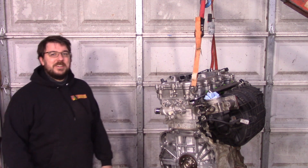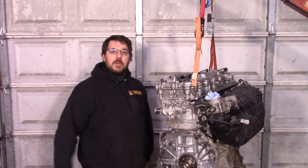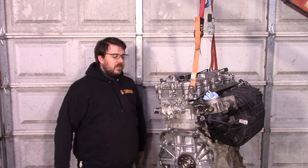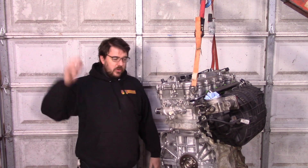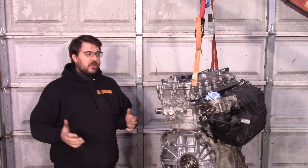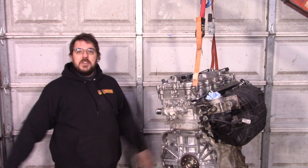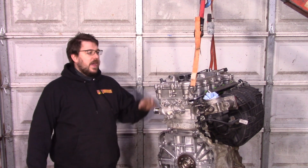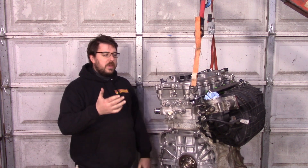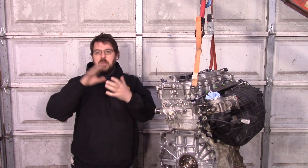That moment you just saw — you have no idea how sweet that was, because that was a confirmation. That was the first camshaft that I have run in an engine that I created entirely from scratch, not just calling up and saying I want a 240-degree cam. Every last point on that lobe — that lobe that I made asymmetric — worked, and it offered me something I feel isn't really in the market: the ability to use a fairly light spring rate and get good valve travel, because I'm accounting for the actual motion at the valve instead of just drawing a typical valve lobe.